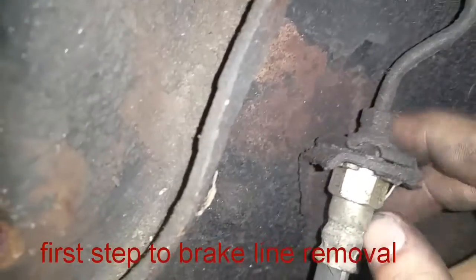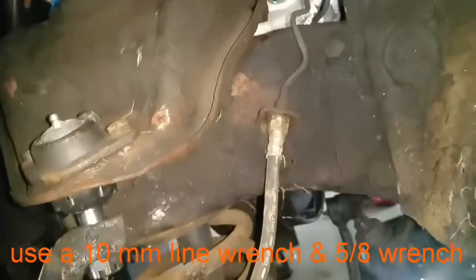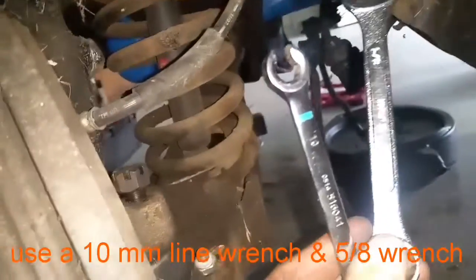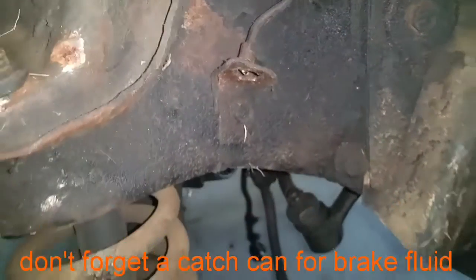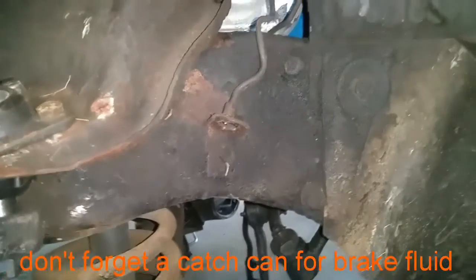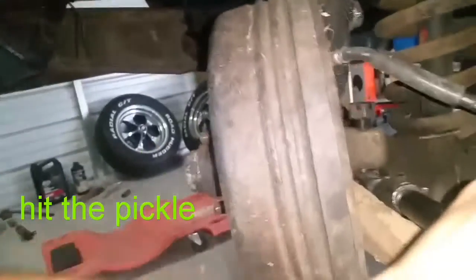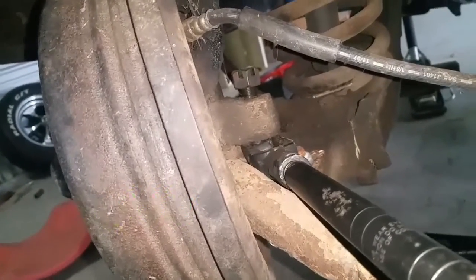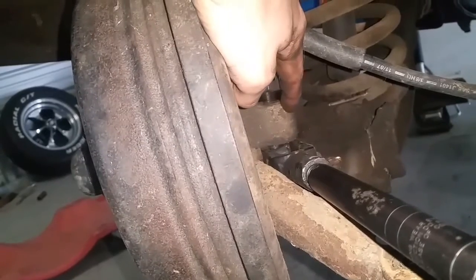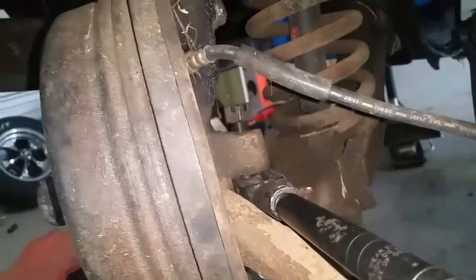The clip will come off — there's also a clip right there that will come off. So I'm going to use my flat head and a hammer to push that clip off. That's pretty much what you're going to want to do, and it's going to destroy the ball joints — but I'm replacing those anyway. Another way to do this would be to hit right where the knuckle meets up with the ball joint to free it if it's seized. But this is going to work fine for me.